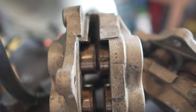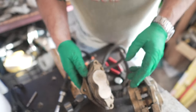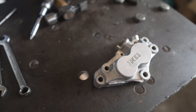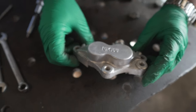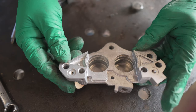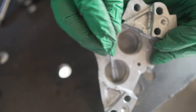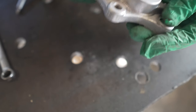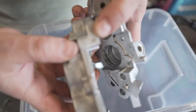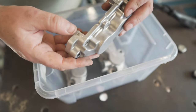Get them to somewhere — if they're moving like that, there's a chance you can blow them out with an airline. So the next thing to do would be undo these bolts and pull these calipers apart. That's what one looks like once it's been taken apart and vapor blasted. I've still got a little bit of corrosion to get out — this is where the seals sit. It's getting painted, then they can all go back together. There was a broken screw in it — I'm going to show you how to get that out.